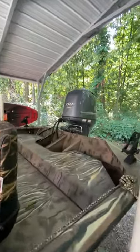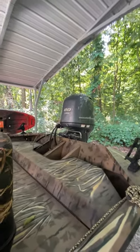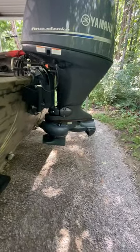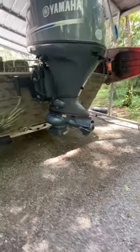I've got an 80 horsepower — it's a Yamaha 115 80 jet. So that's a 115 power head, and once you put a jet lower unit on it, it reduces about 30%, so it's 80 horsepower at the jet. If it had a regular outboard lower unit on it, it'd be a 115.